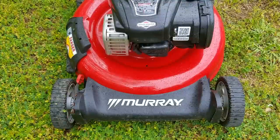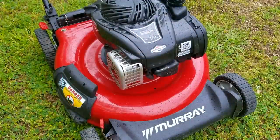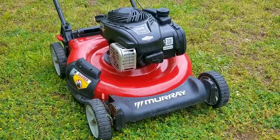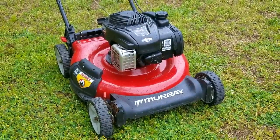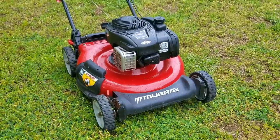It looks like we were lucky enough to save yet another mower from the recyclers, but I do feel bad for the person who tried to work on this mower and just barely missed out on getting it running again. I'm not sure how they could have missed the governor linkage just laying there on the mowing deck — when I first saw the mower, I saw the linkage immediately, so I didn't even bother trying to start it until I was able to put it back on. You don't know what kind of conditions they might have been working in when it happened. So my question is: have you ever put a mower, blower, or trimmer back together and forgot to replace something like a fuel line, a throttle linkage, or even the spark plug wire? It's happened to me a few times, but luckily it was never this bad. Thank you for watching — please feel free to ask me any questions about this project or your own projects, and I hope to see you in the next video.